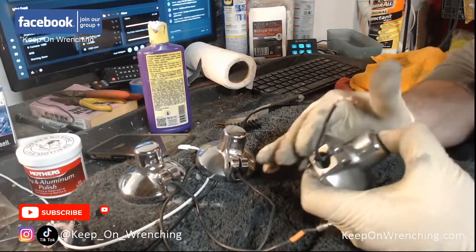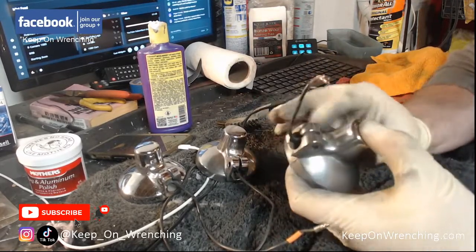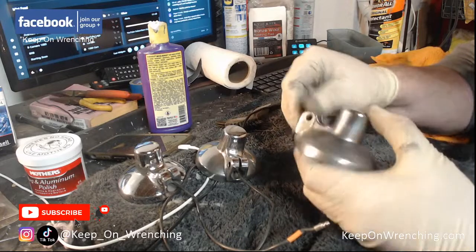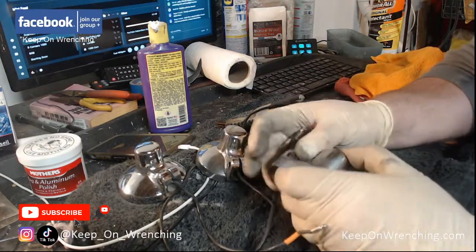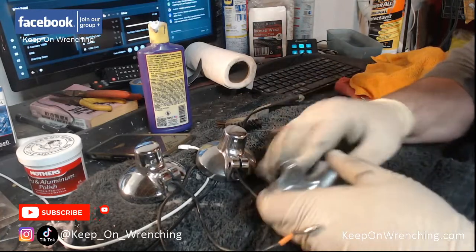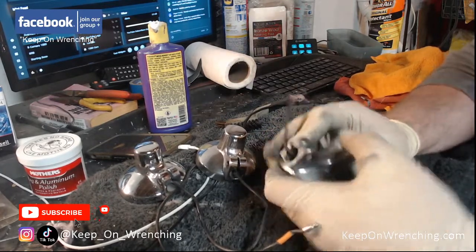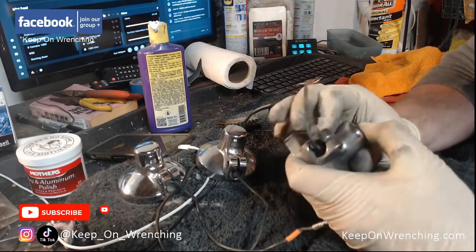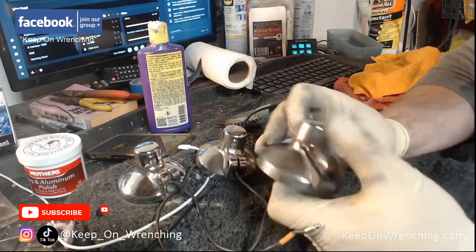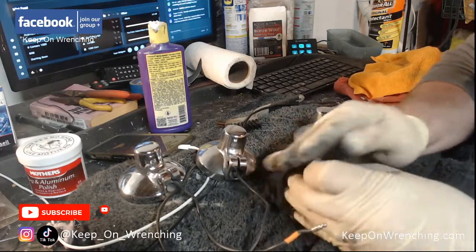And I committed on the CL tank. That's that black tank that I showed you guys. It was just full of rust, and I'm saving that tank. I cannot believe that I was able to bring that back. So as long as your tank doesn't have holes in it, try to clean them out, man. I went through about four rounds of vinegar, and I'm on round four now, and it's pretty good. On rounds two and three, I took 100 washers, put them in the tank, and I basically just swung around the tank, rattling out anything I could get until that all kind of came out clear.